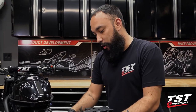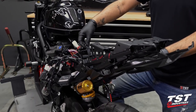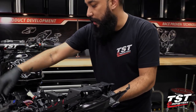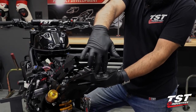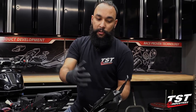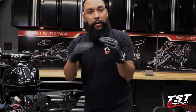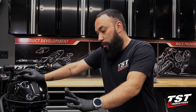So everything is stripped down. As you can see in here, we literally have nothing. The only thing that's left in here is this battery retaining strap to secure the battery to the subtray. Everything else is gutted out — all the wires are right here, the ABS delete pump, everything. We are going to make some cuts. I do want to note that we had the tip sensor sitting back here; it was actually mounted in these two holes. Being that we're removing this completely, we do need a place to relocate our tip sensor. The tip sensor is crucial because it cuts off the fuel should you go down on your bike — there's a little ball inside, a leveler, that if it goes out of the set parameters, it cuts fuel and shuts the bike off. So that's really important; we do want to retain that function.